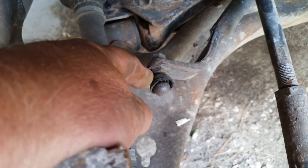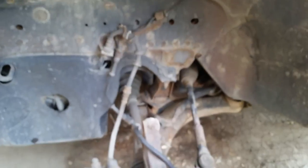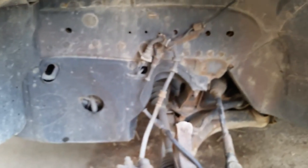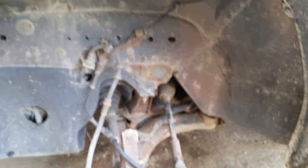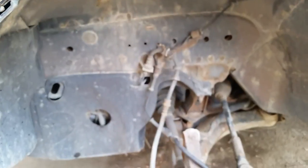Here's the brake line bracket we were talking about earlier, here's the axle brake line, and here's the stabilizer link still in there. We'll get a wrench on the back of that nut and remove it, then we'll be ready to reassemble. The nice part of buying the whole strut assembly is no spring compressors to worry about — you get a new spring, new strut bearing, and new strut. There's nothing to disassemble or reassemble, or wonder whether you should have changed the other parts.